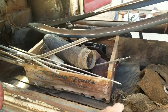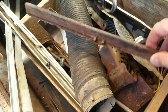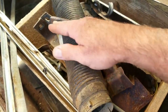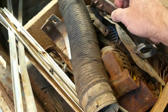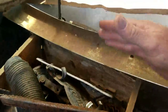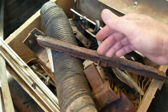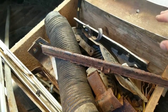There is also a different seat bracket — they saved them, thankfully, hopefully both of them are in here. If you notice, this part is different where the latch is, so it would definitely need some modification to make it work on these old ones — maybe narrower or wider. They're probably very specific to these early cars. I could put in a set of later seat tracks and I know guys get all freaked out about that, but to me it's like — it's just a seat track. The rest of it looks the same as the rest of the car, and that to me is not a huge deal killer, but for some people it would be.